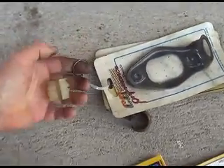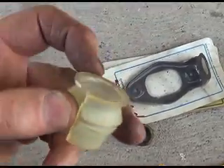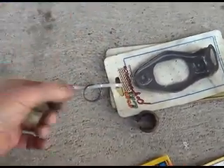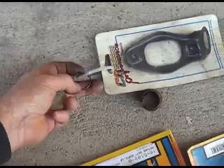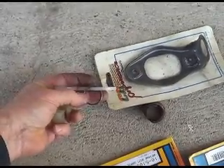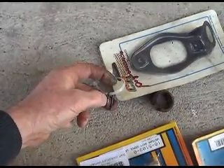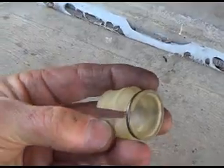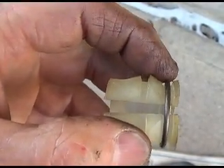I'm going to take this piece of plastic nylon, put it in the hole — there's still a snap ring. I haven't decided what I'm going to do with this spiral clamp. I think I'll put it on, set it in place, and then see if I can get the rod started. It's a little bit of a puzzle. It can challenge your patience but it's definitely worth doing, and if you're having any kind of shifting issues you definitely want to look into this. I've just collapsed this and put this capture spring right there — that kind of holds it tight on your shift shaft.